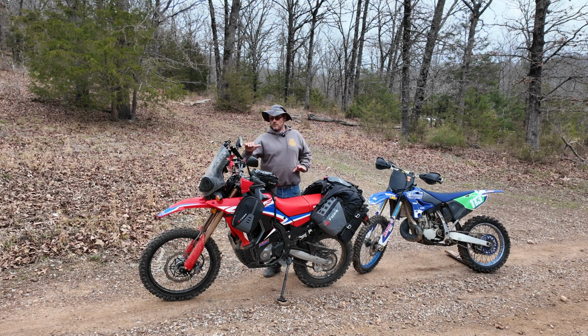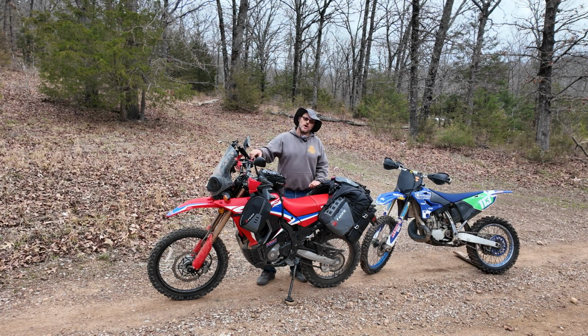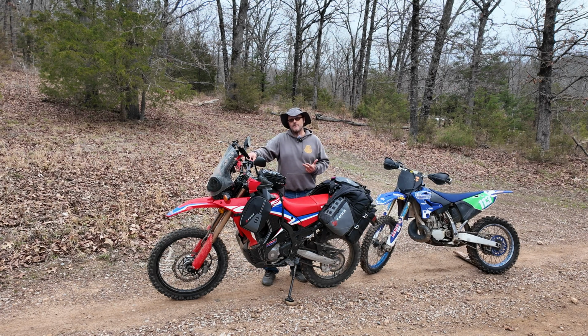Now, in the examples that I'm going to give you, I'm going to hit a square-edged rock. It's a 3 3/4 inch rock. I'm going to hit it at 10 miles an hour, 15 miles an hour, and 20 miles an hour. I'm going to be hitting it on my 300 rally. My son's going to be following me on the YZ250. This bike has 22 pounds of air pressure in it. I'm also going to show you a couple of clips where I lowered it down to 15.